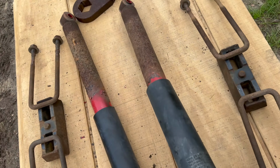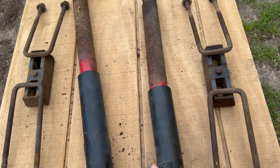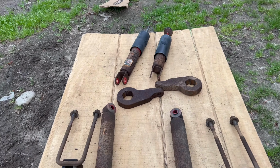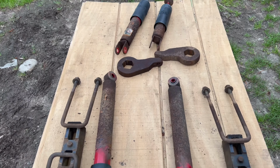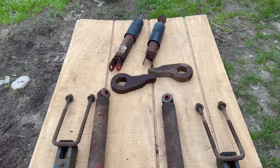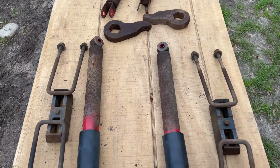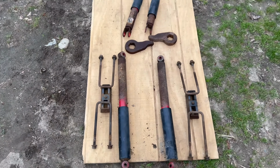But yeah. So basically, this side of my truck, because I made sure I kind of kept everything on the same side. I just brought it from the driveway over here. Yeah, you passenger. That's why my passengers always complain, man, your truck rides like crap. See, I'm over here with the good stuff. They over here with the stuck shock and the shock that's all the way down. That's nuts. But yeah, so that's it. I'm gonna take this thing for a test drive.